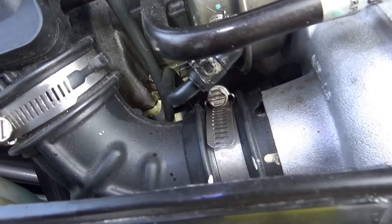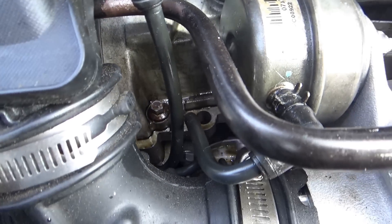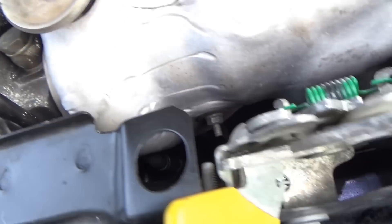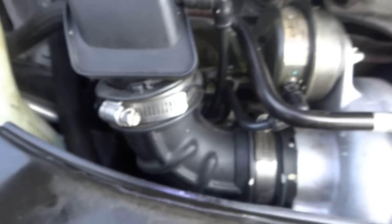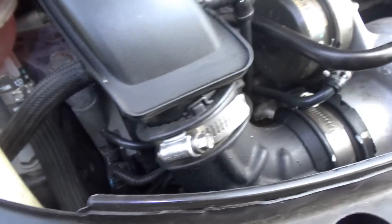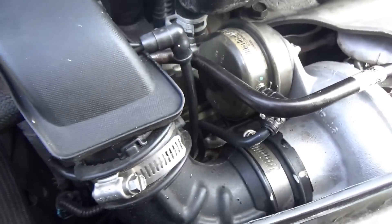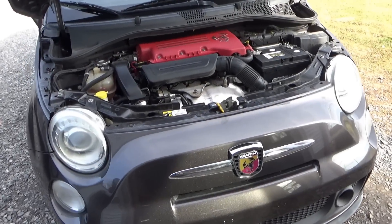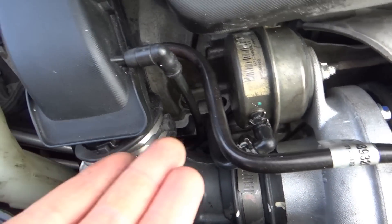Looks a little oily right here. Where is that coming from? A valve cover gasket? Dripping out of the exhaust, making a smoke show. The owner said that right before this happened they fixed some oil leak — maybe they didn't fix anything. I took the Fiat for another spin after tightening just this one valve cover bolt. I don't see a drop of oil, there's no smoke. So the owner's gonna take it — I told them check the oil once a week, let me know if anything changes. Should be good to go. Thanks a lot for watching. Bye-bye.